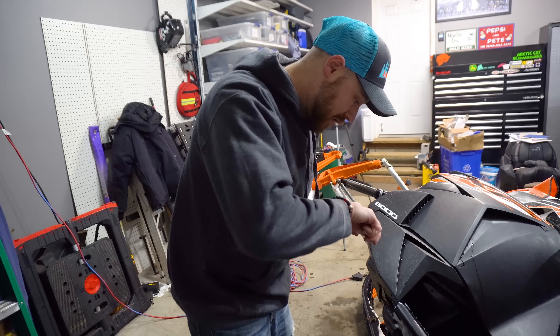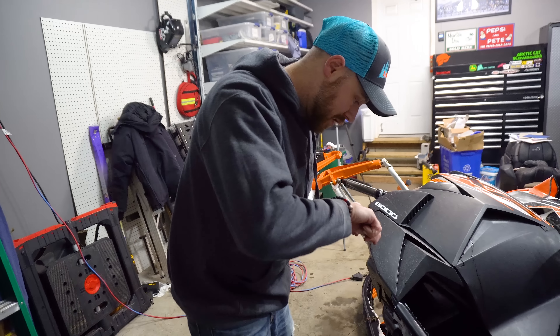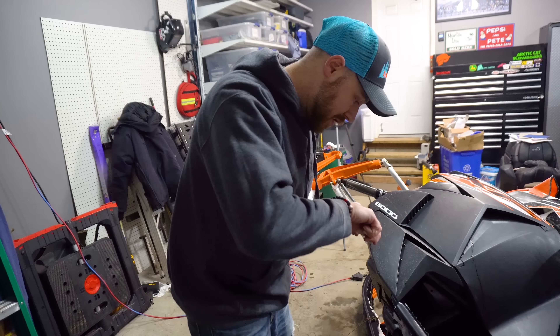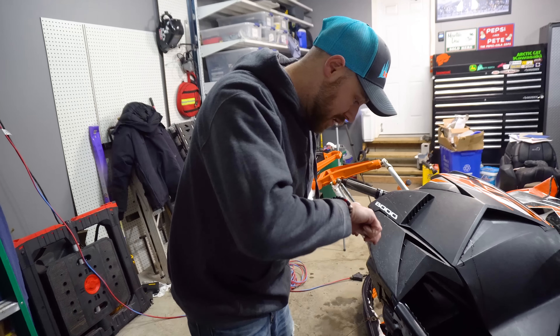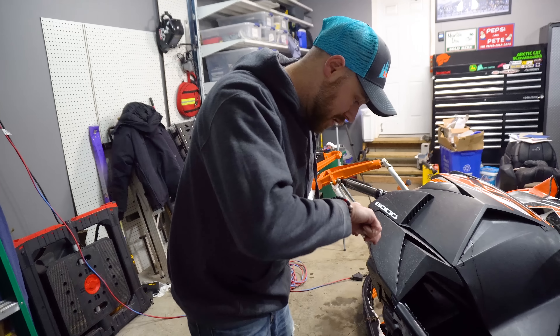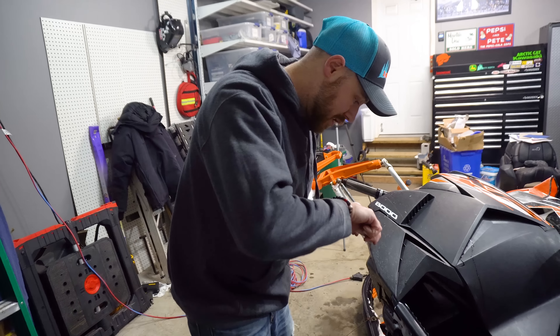Okay, we're probably close — we're going to come to the front and have a look. The hole's not lined up yet so we've got to keep going. Once the slide rail is all the way to the front, you can check your fit with the screw and make sure everything lines up. This is a lock nut and it's supposed to be a one-and-done thing, but it's 10 o'clock at night, Arctic Cat is closed, the hardware store is closed, and I'm going riding tomorrow — so instead, blue Loctite. Blue Loctite is like Frank's Red Hot: you put that on everything. Don't be shy with this stuff, boys and girls.